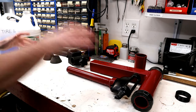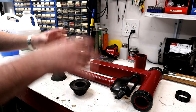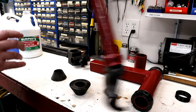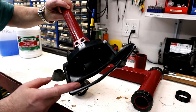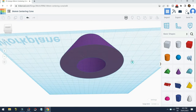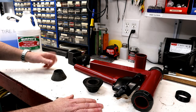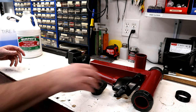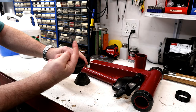In addition to your duck bill mod, you're going to need a centering cone. This will center the wheel on your manual tire changer, which is important because your duck bill is going around in an even circle — so you want the wheel perfectly centered so the rim is always right in the notch of the duck bill. I made these on Tinkercad and 3D printed them. Lucid Auto Works has nice machined aluminum ones, but they weren't the right size for my center post. When the cone clamps down it holds the wheel against the plate, and there's a little pin that comes through so the wheel can't turn.